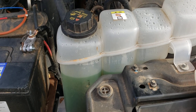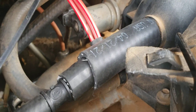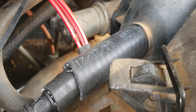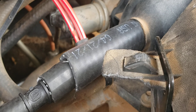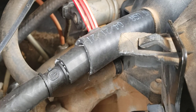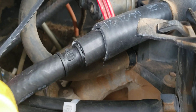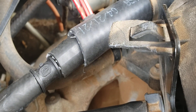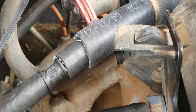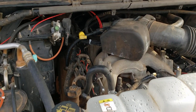So what I did, because I had this apart, was ran into town to the parts store. As you can see right there, got a piece of 3/4 radiator hose — it's an alright fit. If it starts to run loose, I'll just put a hose clamp on it. I got a 3/8 to 1/2-inch adapter, stuck it in the 3/8 hose coming off of the PCV valve, then put a piece of 1/2-inch on, and stuck the 1/2-inch inside the 3/4 hose. Now we're all good to go — fits about as firm as the factory stuff did.